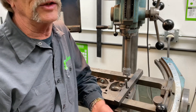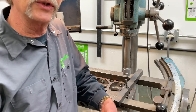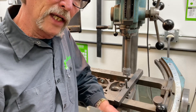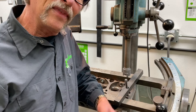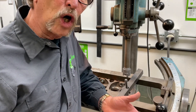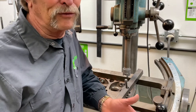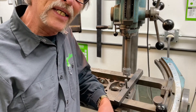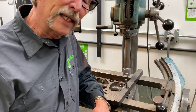Don't guess — and also the depth: measure, don't guess. And then you'll have a complete precision counterbore to accept that new valve seat ring based on center line of the valve guide to place where that new seat ring should be. Then you've got the option at that point to either grind those multiple angles on that valve seat or go ahead and use your 3D fast cut from your friends here at Goodson Tools and Supply to perform machining simultaneously all three angles at one time.